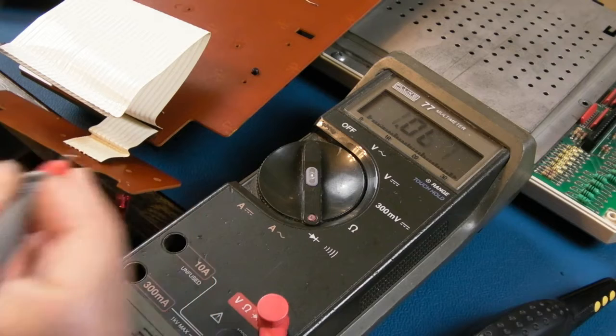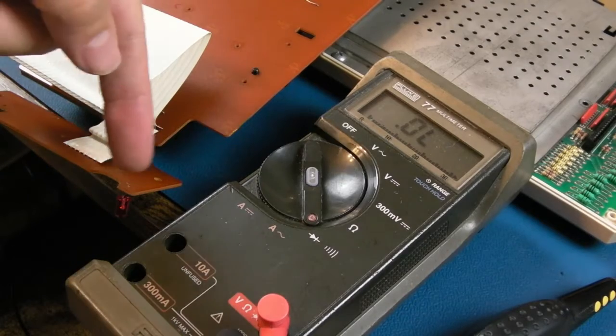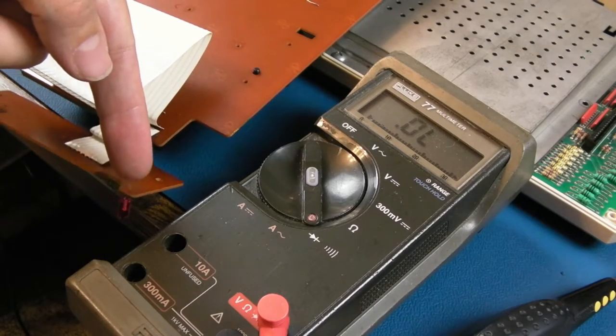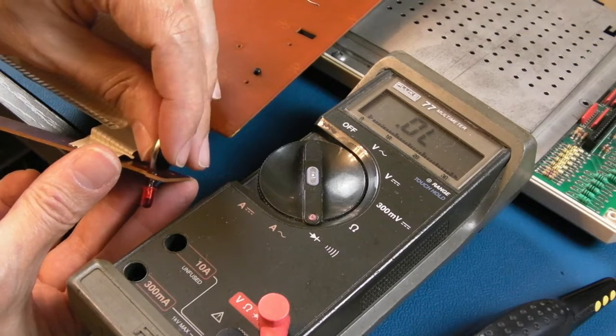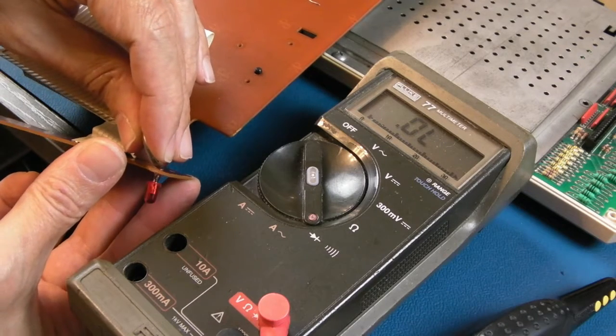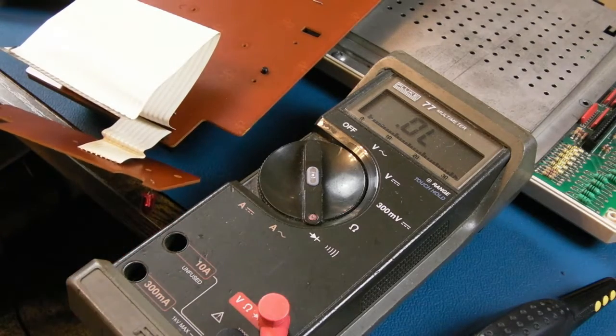Yeah, we're getting a reading there. The other thing you could do, I sometimes do, in fact I've got to go do it now, get a CR2032, just press it between the contacts there and see if it illuminates. Yeah, I'm not sure if I've got enough separation between the positive. Oh, there we go. See that? See it illuminating? Yeah. So we know the LED works.